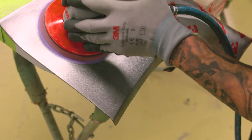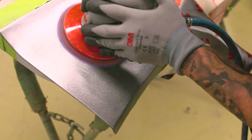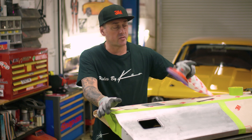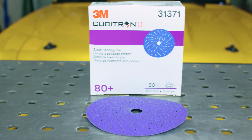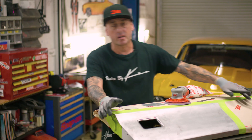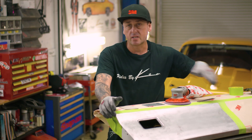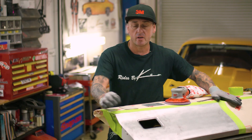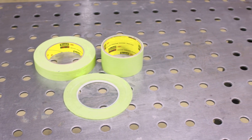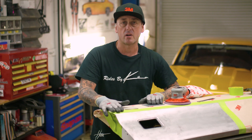The first step on your door, after you've dismantled all the components out of the door, is to get it back down to bare steel so that you can get your area ready for welding. To do this, we use the 3M Orbi with the 80 grit Cubitron 2 sandpaper — it works a treat. We use another cool product of theirs, which is a welding and spark deflection paper. It pretty much protects all the area that we're not working on. And the 233 Plus tape — we use this quite a bit as well because it's quite thick, it will hold all this down so you can cool the area down and it'll hold the paper down as well.